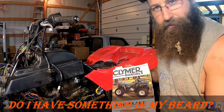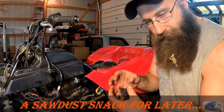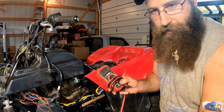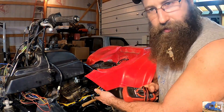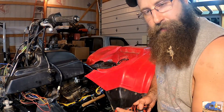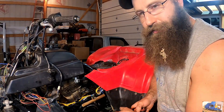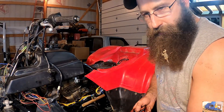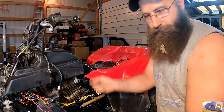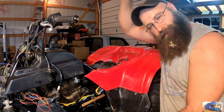The Clymer manual helped, though the wiring diagram wasn't so good — you got those magic boxes with wires going into them and you have to kind of figure it out yourself. The real winner here was the multimeter. We used the wiring diagram a little bit but basically just probed the wires until we got what we wanted. We needed to add in that relay that was missing — the original owner probably had it go bad, started cutting wires and moving stuff, and ultimately never fixed it. If you like this video, don't forget to give me a thumbs up, leave your questions and comments below, and don't forget to hit the subscribe button. Thanks for watching everyone!